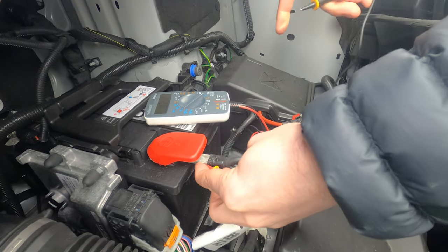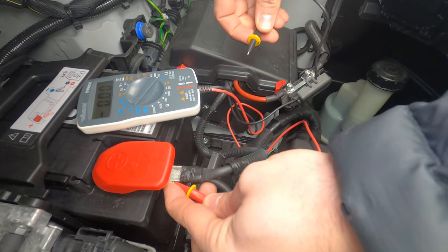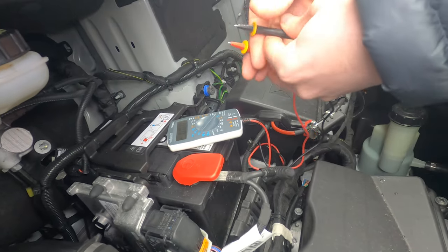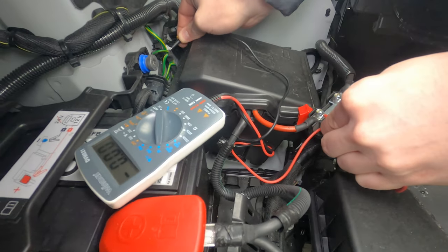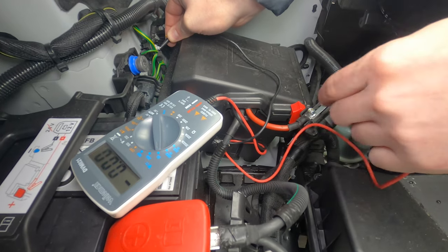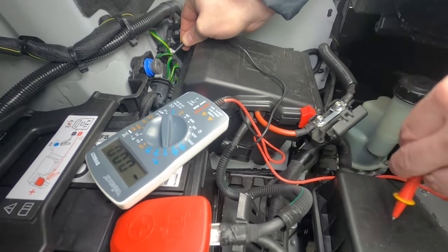Make sure that charge is reaching your battery in the back of your van — follow the cable. The cable comes out of the fuse box and goes onto the fuse. Using the probe, ensure that voltage is held all the way down the cable. At the first connection we have a break, so there's obviously an issue between the fuse box and the fuse. You need to do a repair — either tighten the bolt up or replace that connection.